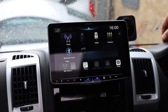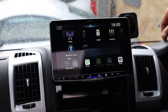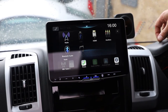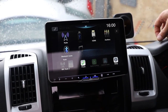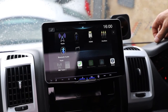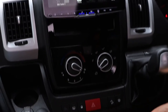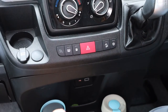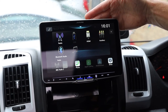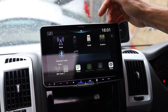We haven't connected a camera to it because there's already one fitted on a separate display on the dashboard. What we have done is integrated it in our usual style — we've retained the steering wheel controls by wiring into and talking to the CAN data behind the scenes. We've also retained the factory USB, which is for phone charging. The Alpine comes with two USB flyer leads — one in the top pocket for Apple CarPlay and Android Auto, and the other for charging.